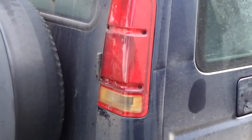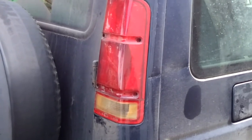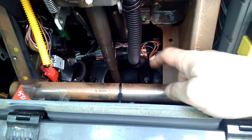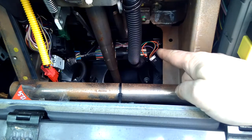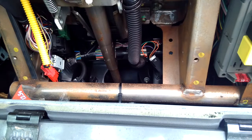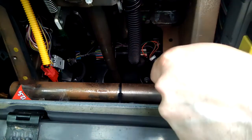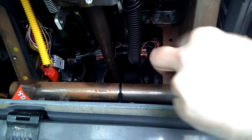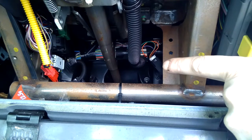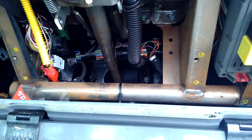I'll just give you a few tips on setting it up after you've installed it. There's your nice new brake switch installed there. If you keep turning it clockwise when you put it in, it will overgo and come out again. When you install it, you need to have your engine running so that the servo assistance is on the brakes. Then push down the brake pedal with your hand as far as it can go — it'll go further than if the engine wasn't running. You then install your new switch and turn it around to lock it in place, then let the pedal up and you'll hear the little ratchet in the switch go click click click click as it finds its position. If you don't do that, you'll find it doesn't really work.